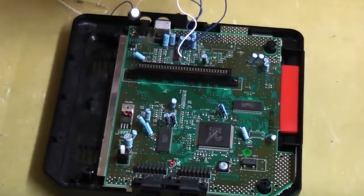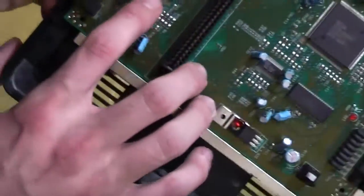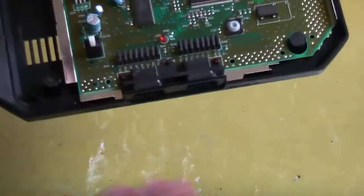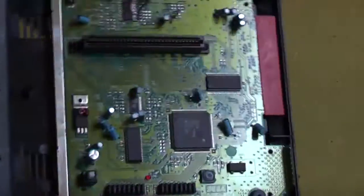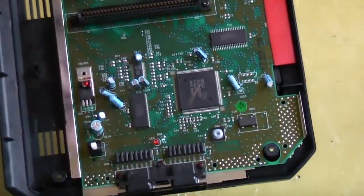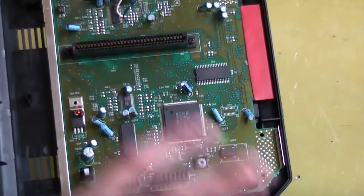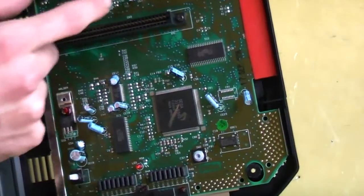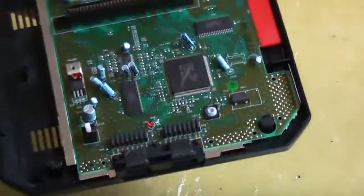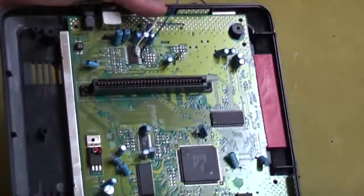I'll pop the shielding off. You can see I've already tapped on some wiring here for some testing. The video encoder in this one is actually a Sony, so the output on the machine is fine — in fact, it works really well. But as I was saying, the solder points are different. I've had a few guys write in and say they really want to do the English and Japanese switching and 50 and 60 hertz switching, but they can't find the points. Thanks again to Sean, I'm finally able to show you what to do if you happen to have one of these machines.